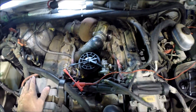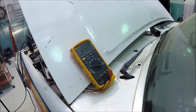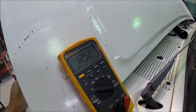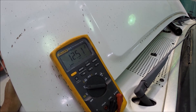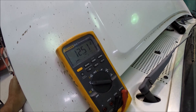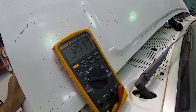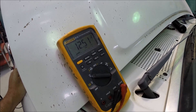Come around and look — I've got the meter set up right here. You can see it's showing 12.5 volts, and that 12.5 volts is essentially our battery voltage. The reason we're seeing 12.5 is because the red lead is hooked up directly to battery power and the black lead is hooked up to the wires that go to the glow plugs, so we're getting ground through the glow plugs. Now when we crank this engine, we should see this number drop to zero, or something very close to zero — it shouldn't be more than about half a volt. If we see anything higher than half a volt, that tells us we've got excessive resistance in the contacts of that relay.